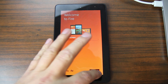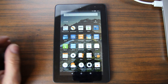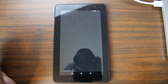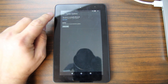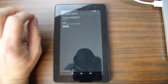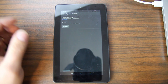So if you get one of these devices, do what I'm doing right here — follow the steps. This is like when you first turn it on. Go into Settings > Device Options > System Update and you can see up here that the firmware is currently Fire OS 5.3.2.0. This firmware can be downgraded to 5.3.1 — and no lower, only that version. Downgrading to that version is what we're doing in this video, and it will allow you to get root access and use my super tool.